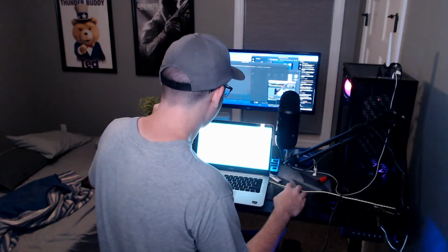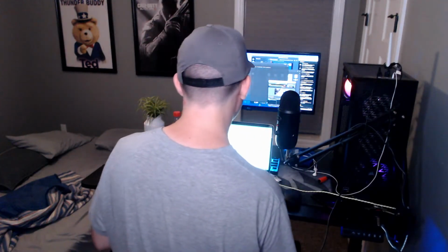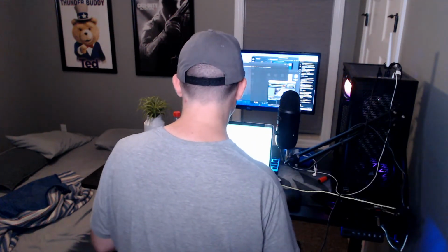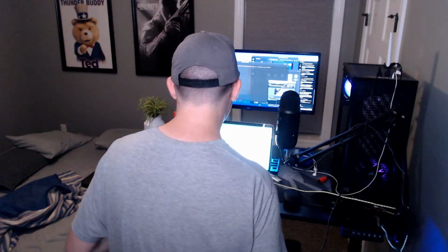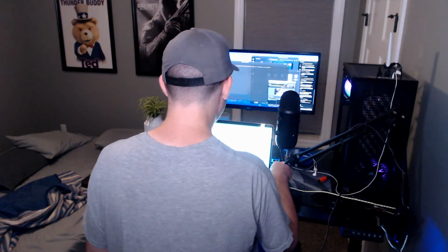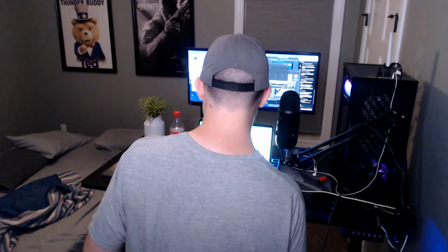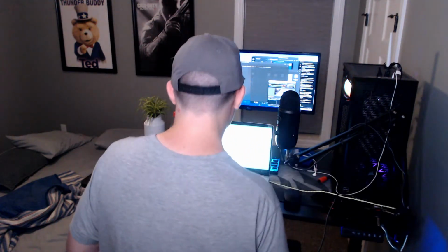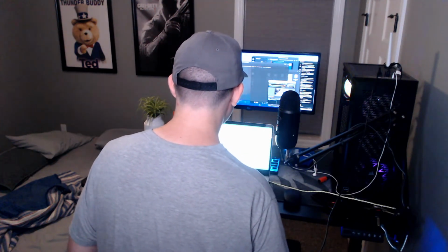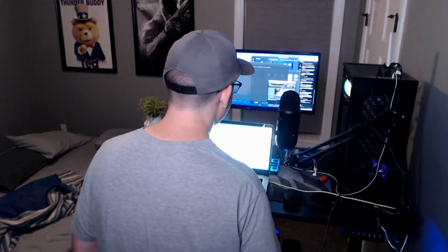But so after it actually boots up, you'll get a Plan9 console here. It spits out Plan9, then a whole bunch of stuff. You get some CPU stuff. It actually detects, I believe, my Wi-Fi, because I see IWM or IWL 54 megabits port, but that doesn't mean it actually works. I also see /lib/firmware/iwm does not exist, so I think it's looking for something that's not on here.